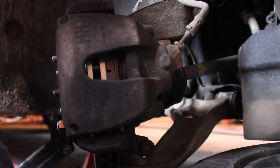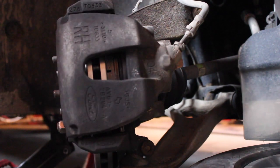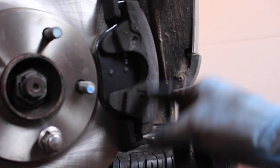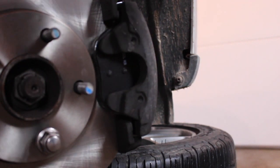Here's the new pad — see the difference? New thickness versus old thickness. It's quite a bit of wear; I'm not sure how many miles are on these pads but I can only guess quite a few. Get your new pad in there. If you compressed your caliper back enough, the caliper will just slide over. Now we've got our Torx bits fitted back into their holes and there's the little clip for the front of the caliper — it goes in these two holes.